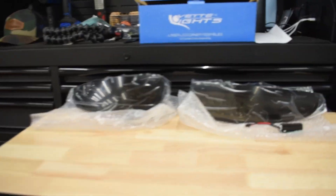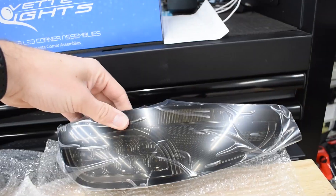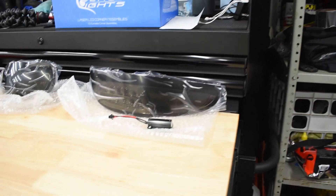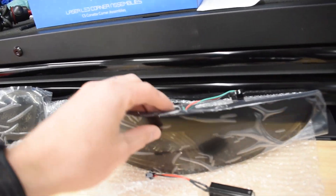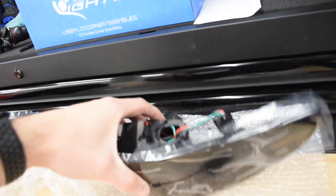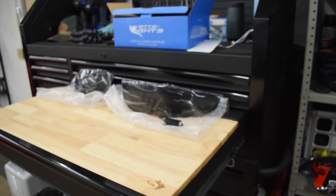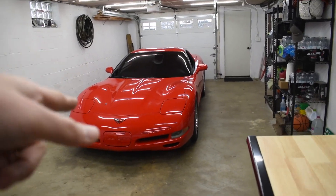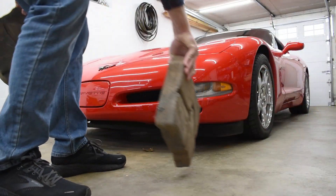So we're going to continue our lighting mods with Vet Lights — these guys are pretty freaking awesome. These are the front corner lights we're going to be replacing from the factory OEM ones. From my understanding they have a switchback function, so we'll see how that works when we put the turns on. We do have some small resistors to mount on each light so they don't hyper flash. These lights are plug and play — this plugs into the old bulb socket, this would be for the resistor itself. All we have to do is get the front end of the car up in the air a little bit, pop those bad boys out, put these bad boys in, and see what it looks like.